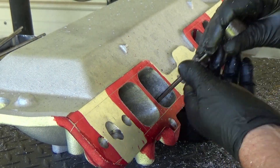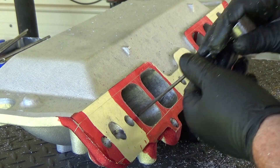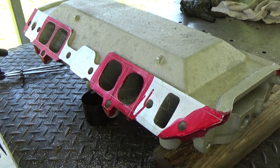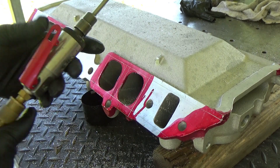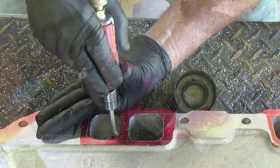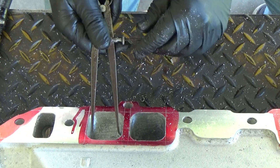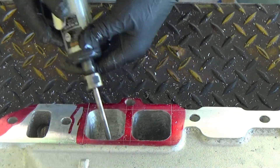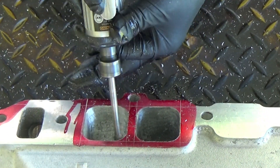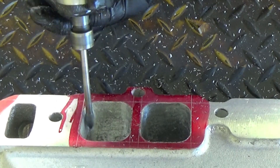I'm using my fingers to feel out any bumps or humps, and using my drafting calipers to put those scribe marks — you can see those scribe marks inside the port. I keep grinding until I can feel it's not dragging as much. I put my scribe marks in there and just grind on that wall till those marks are gone, doing that two or three times before the port is the same size going back into it.